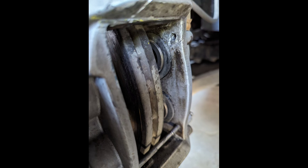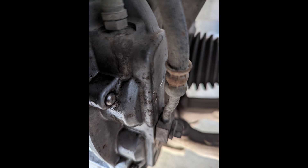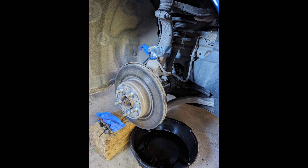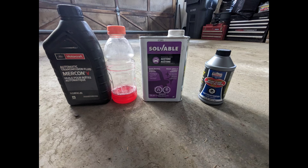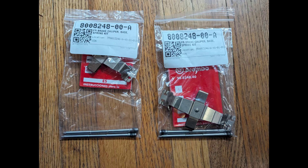In the back, I had to remove the caliper in order to get it off. I took that bolt off the caliper so I could remove the entire caliper and bring it to a friend's house. We ended up heating the caliper with a torch and trying to use punch tools — the heat-and-beat mechanism a lot of mechanics use — but it did not work. I used acetone with ATF fluid in a 50/50 mix, let that soak for a good hour on both ends, and nothing would work. In the end we just had to drill out that pin from the back side.